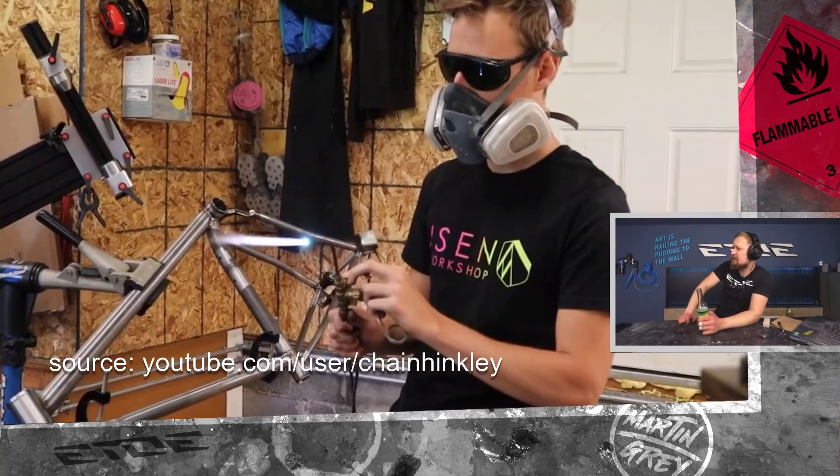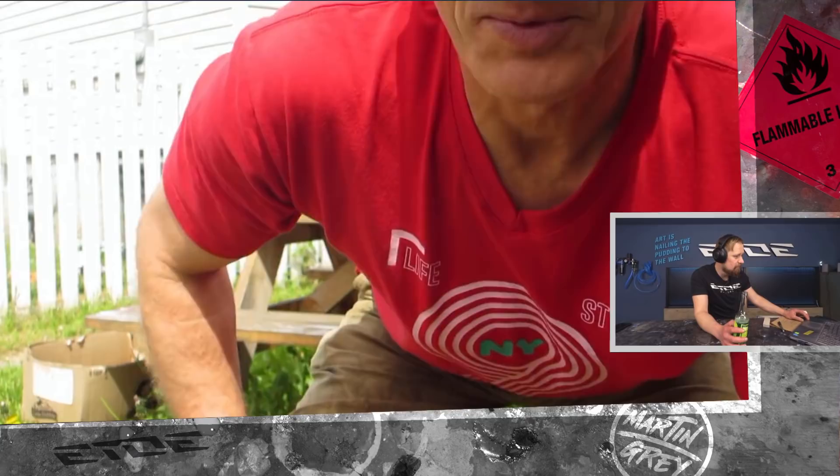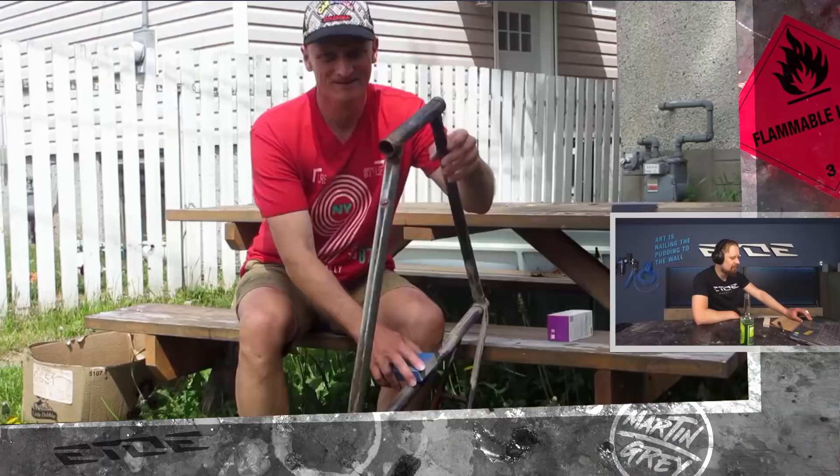Can we have a video or photo of a fire-brazed frame? If you put your frame into the fire, you will ruin this frame. It kind of works, but it really oxidizes the metal too — it not only oxidizes the metal, it also cracks the metal and it will bend all the way everywhere, because the tubes are sometimes very thin. Don't put your bike into a fire pit or use fire to remove the color. I recommend media blasting — that's the safest, best, and fastest way to strip the frame. If you have a lot of time, you can use sanding sponges or dry sanding paper. Use dry sanding paper on steel frames. I have a stripping video if you want to see how to strip a frame by hand, but never use fire on vintage steel frames.